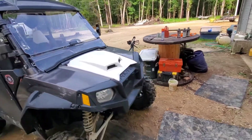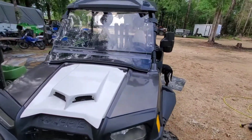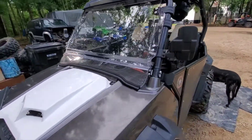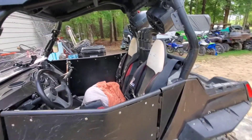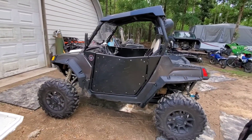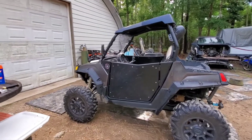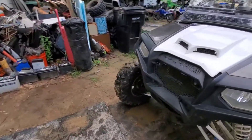That's the route I'm taking, and we'll see the difference in the different clutching and see if that helps anything and gives me a little bit more RPM. I don't want it releasing whenever you let off the gas — the clutch just disengages after you start slowing down. That should prevent that from happening. I'd rather it just start slowing down whenever I let off the gas, especially for my son driving it.